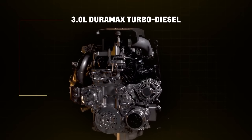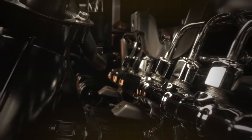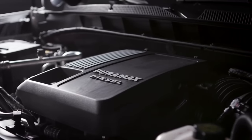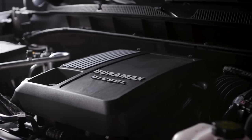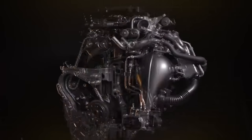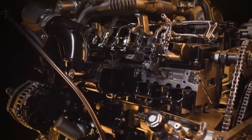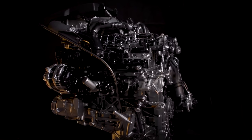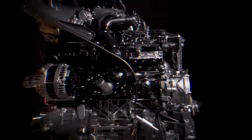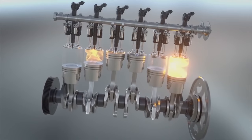It's a little too soon to know how these emission systems will fare long-term, but looking at other examples, these systems will likely become reliability issues down the line. In terms of major issues, there definitely seems to be a no-start or long-crank issue popping up on some of these trucks, which appears to be related to the camshaft position sensor — though it also seems intermittent and isn't always the cam position sensor. What's really annoying is that if it is the cam position sensor, the transmission has to be removed to access it, and the cab will probably have to be pulled depending on the application.